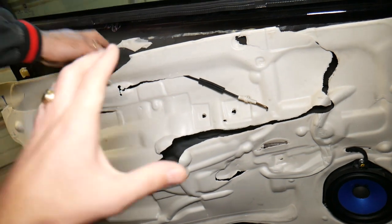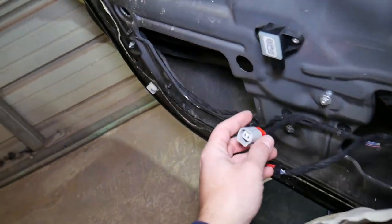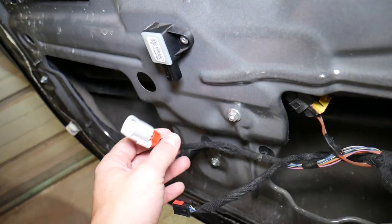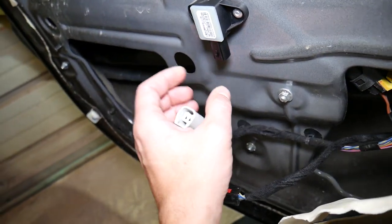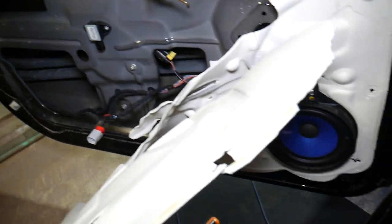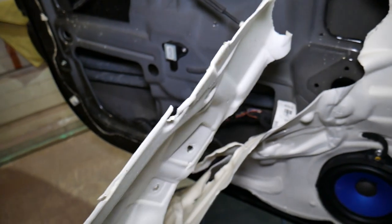Now what causes that code — we had to remove the door panel to work on the release door cable, and that cable wasn't connected correctly. This is for your side crash impact sensor on the Fiat 500 right here. So either you have a bad sensor, a bad connection, or the wire is pinched somewhere. You need to make sure that when you connect or disconnect anything, the car battery is disconnected — otherwise airbags can blow up and they can kill you.